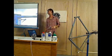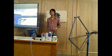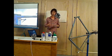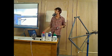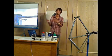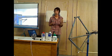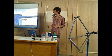Yeah, as of now, definitely. As of now, I'm doing about five at a time, since we've got five stands. We probably could bring more in. There's also racks in the booth, so you're not always doing the same thing to each one. You'll have some primed, hang them up, and then color in others. You don't want to get any of that color on the ones that are primed, so it's a matter of dividing up your booth as well, which we're in the process of doing, putting in curtains and whatnot to prevent overspray.